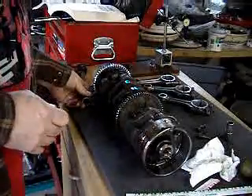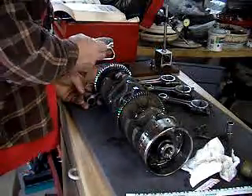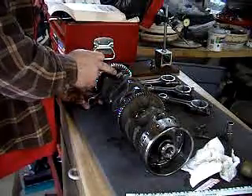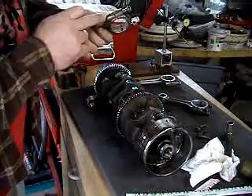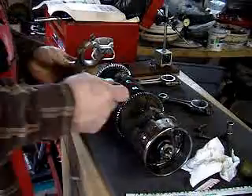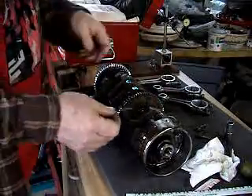I had it backwards because this gear goes that way, right? I should see all the writing on the caps, like here and here. This writing should be visible with the crankshaft orientated like this — one, two, three, four, something like that. So I had it backwards.